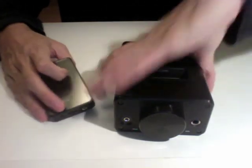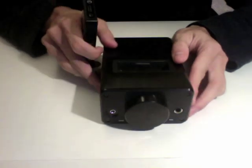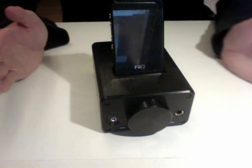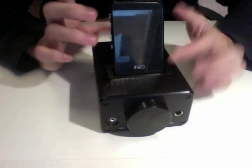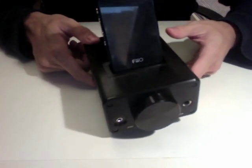When you plug this in connected by USB, normally this headphone amplifier on the E9 won't work without the E7 — you'd have to use the normal auxiliary input. So basically, you use the E7 as your portable amp during the day, and when you get home you just slide it into the E9. At that point, this becomes a powerful USB DAC and headphone amplifier. The E7 becomes the DAC for the entire system, the E7's amplifier is bypassed, and the system uses the amplifier in the FiiO E9. So you get a decent amplifier plus a very decent DAC, which you can plug into your laptop or desktop — making it a very cheap hi-fi system.